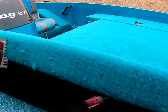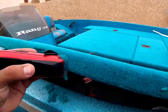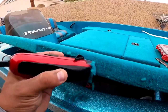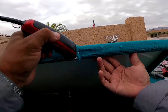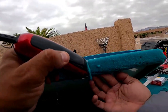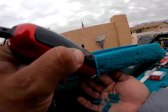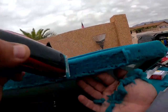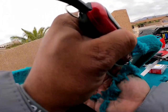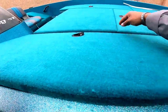For 20-ounce, especially 24-ounce, how you get it to look good once it's seamed in with hatches is you're going to have to go in there and give it a haircut. I would try to give it an angle so you don't see that giant line. But right now we're really just trying to trim this in so the hinge can sit in there. The hatches sit in there just fine without the hinges right now. If I account for the thickness of the carpet where the hinges are going to sit — inside and outside — the hinges will sit in there and the hatches will close correctly without binding.